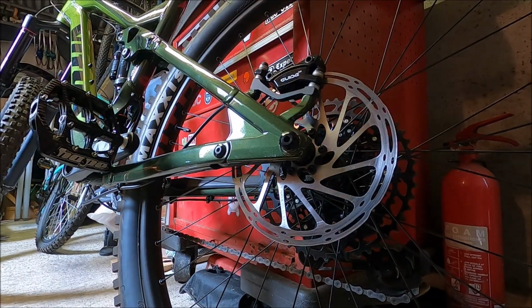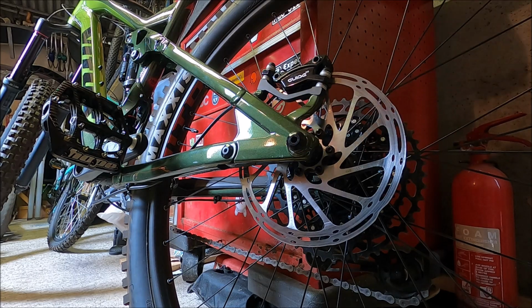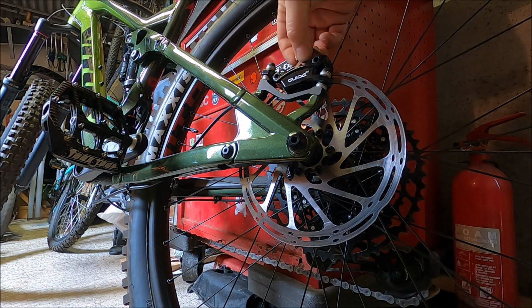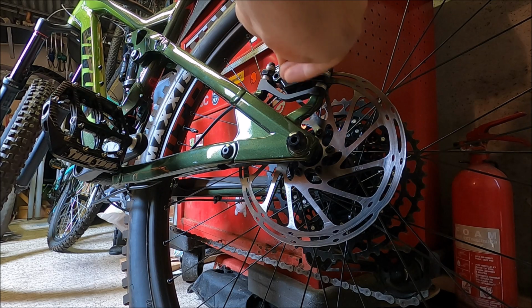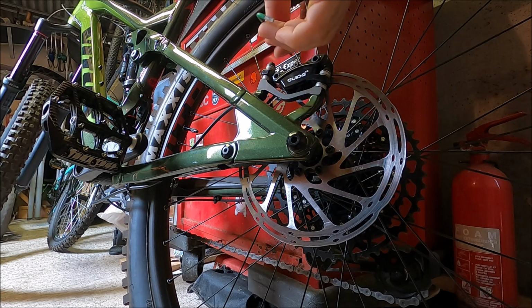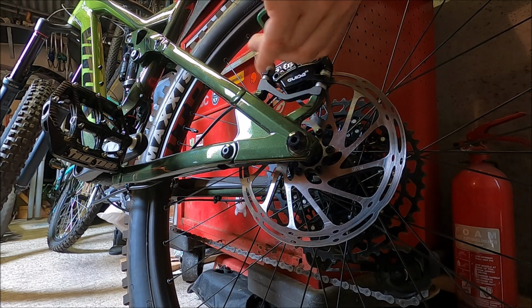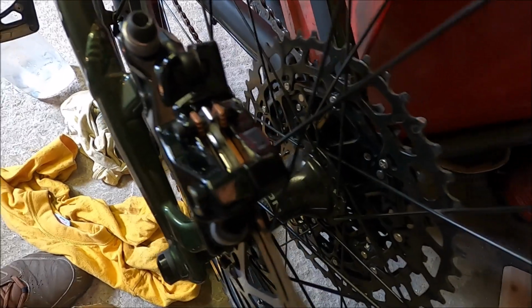Okay, so grabbing those pads, I did put an L on my one there. If you can see, I don't know, but it's the L. So that's the left hand side for me. Just going to slip those in the top. Like so. Now we need that T10, the retainer bolts just to go in here. And then once that is tight, obviously, we do not need to forget the circlip which goes on the opposite end. So that is now all in position on the top here.